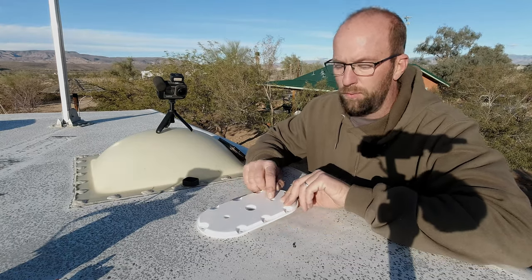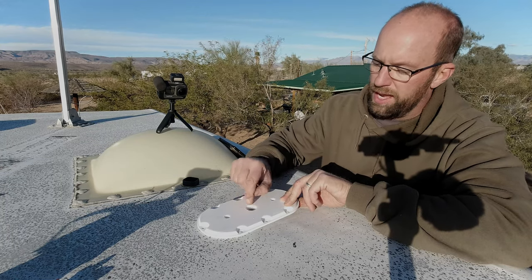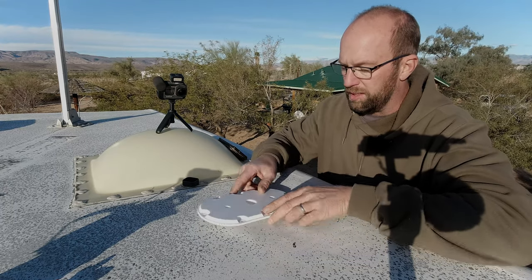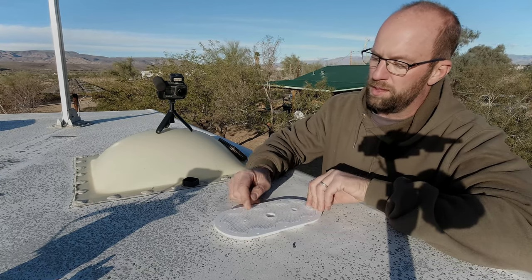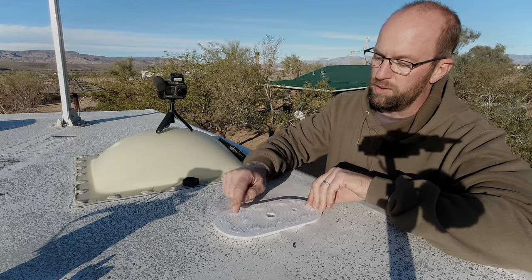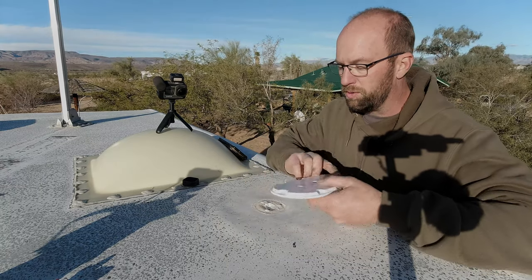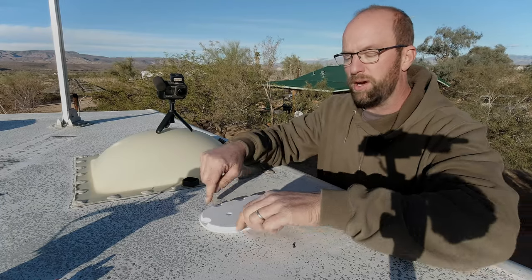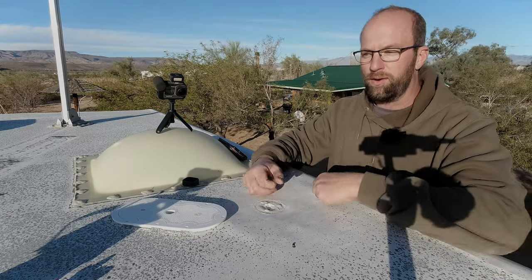What this mount has is a hole for an SDR radio — the cord is on top. I couldn't find anything that passed through the bottom, and I have a cable inlet that'll seal in here, and this section is for an FM radio. If I orient it like this, I don't have to drill any new holes in the roof. I have supports underneath that, once removed, allow the SDR radio cable to pass underneath and go down the existing hole. The only new holes I'll be adding are the eight screws to mount it down to the roof, which I hope is going to be in better condition on the outside — it certainly feels like it is.